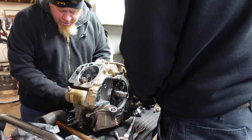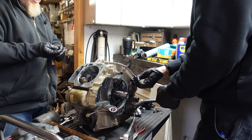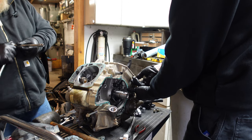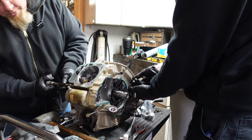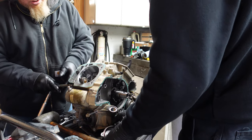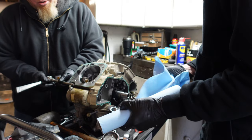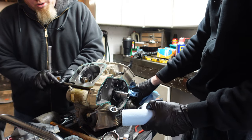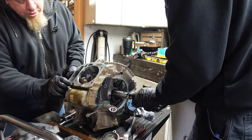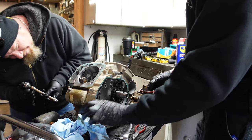I'm going to put the oil filter stuff with the water pump stuff because it all kind of goes together. With the 850 and 1000, there is an oil radiator we have to remove. If you're rebuilding your motor because you accidentally swamped it, you're going to want to replace that because it gets clogged up with mud. There are metal shavings coming out of the oil filter cavity — while Seth is removing the starter, I'm playing with the flakes of oil and crap.